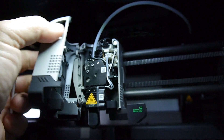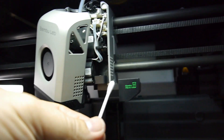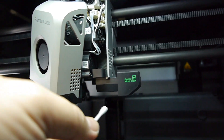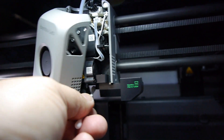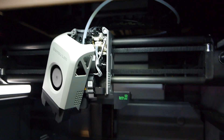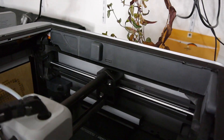After that, I went and cleaned the LiDAR camera lens. It's super easy — you just take the cover off and you can see where the camera lens is facing down, right there in the bottom right corner. I got a cotton swab, put more alcohol on there, and wiped everything clean. While I was in there, I was just looking around cleaning everything in sight, even the sidewalls and any ledges.